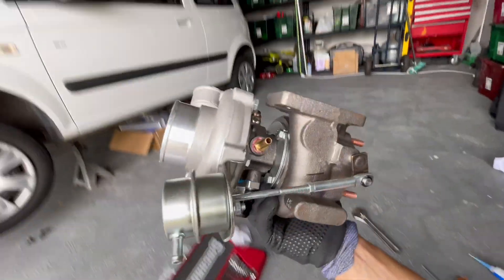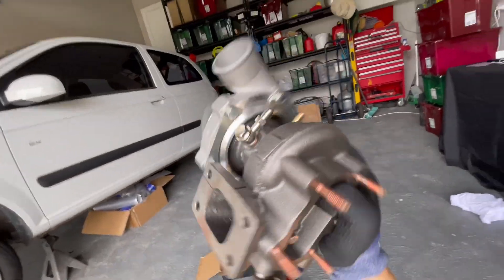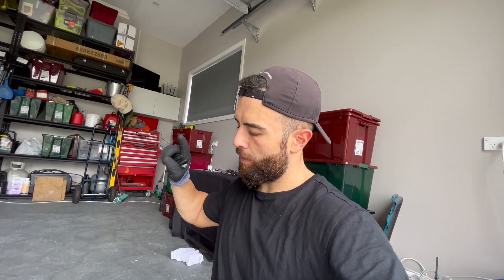The turbo has got all the bells and whistles and it's ready to go. I'm just going to bolt it up to the car because hopefully we don't need to take it off anymore. You can still access the sump with the turbo on, but you want to know where the oil return line will go, so the turbo will be a good indicator of where to aim before we do all our marking.